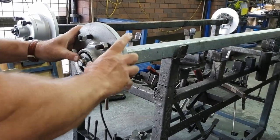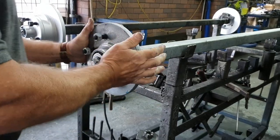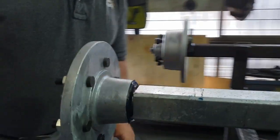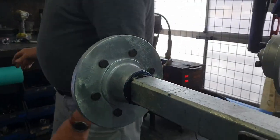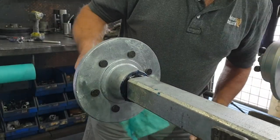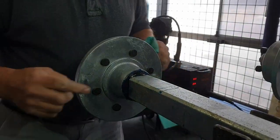I'm just going to put this on and lock up the hub. While I'm doing that, I'll explain: at the back there, you've got 15mm between the back of the shoulder and the back of the bearing — that space is where this seal sits.